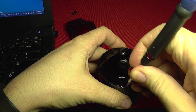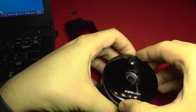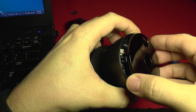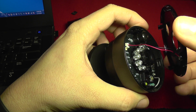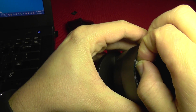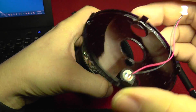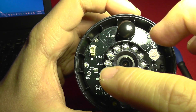You will just make a bit of space like this and the cap is pried open. Take care not to pull it apart as it has the microphone wired to it. Take the small plug out and now you have separated the front plate and the microphone from the rest of the camera.